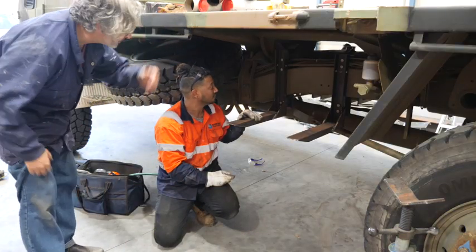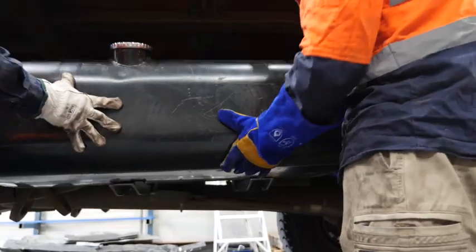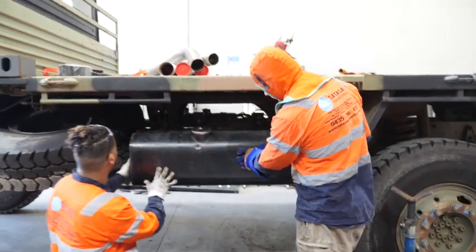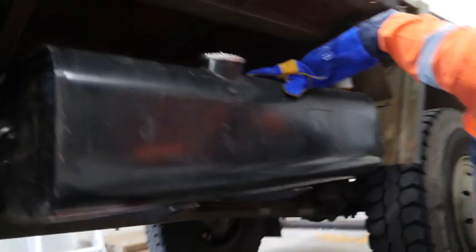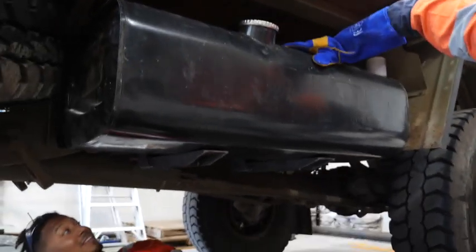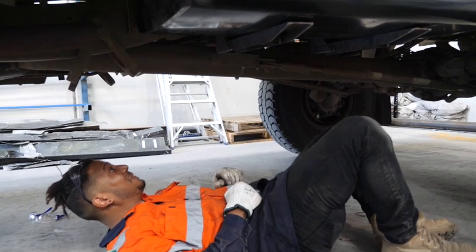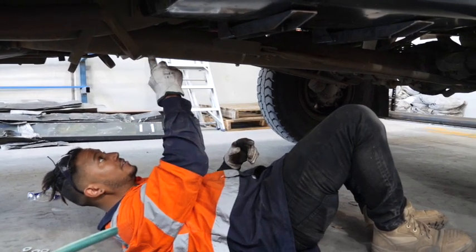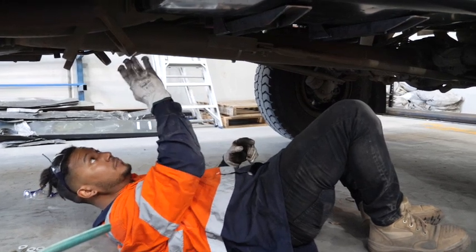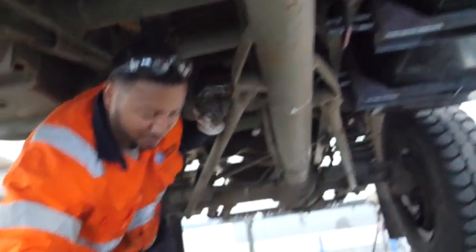It's going to work well. I mean, I would never have been able to do this. Not even close. So 20 mil becomes 10 mil now. You're going to have to grind those little spot welds off. Inside there I've got 10 mil and I'm touching your bracket. So if we go another 10 mil, you'll have 10 mil in between that and your tank. I think it might be better. We'll just cut a hundred mil off theirs.